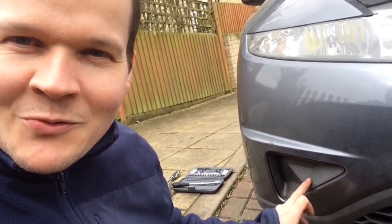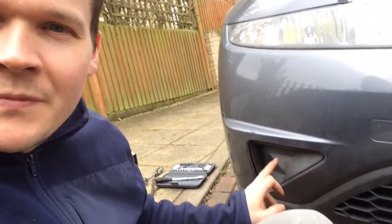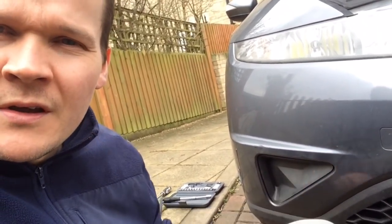I'm going to take the car for a spin and see what it sounds like now. Just driven the car and it's about 60% better — there's no sort of exhaust resonance now, and those two washers have taken that mount up slightly, taking away any vibration that was there. There's still a tiny throaty warble at around 1300 RPM — not more of a vibration but like a warble. I don't know if that's standard, so give me a comment down below.